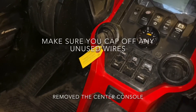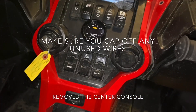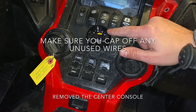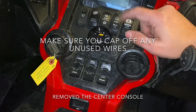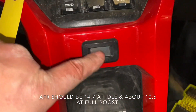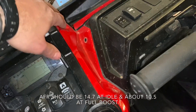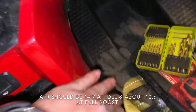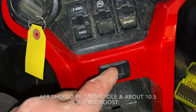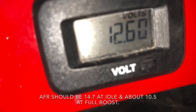I kind of like having it there — it does cover up the Honda logo a little bit, but that's okay. I rerouted the voltmeter down below. The wire from the O2 sensor plugs into the back, the power supply for this also plugs into the back — pretty easy process. I took the voltmeter out and relocated it down here into the middle. I just had to take off the red piece of plastic, which had a bolt, two push rivets, and a bolt on the bottom on each side. I cut out the plastic and routed the wires from up top down to there. The voltmeter is working just fine down there.